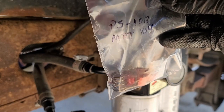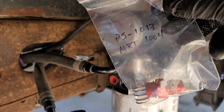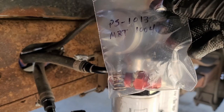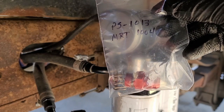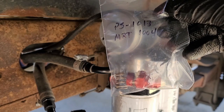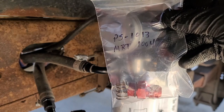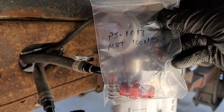FAST sent me a new return fitting and also a new spring. Here's the new kit that FAST sent out. It's PS-1013, MRT-1004. I think the PS is the spring and the MRT is the fitting. This is supposed to take the 7.3 and the 6-liter kits up to 60 or 65 PSI. They had them set at 50, and I think they were getting a lot of complaints with people's regulated returns — these actually come in the new pumps now. My pump is six months old and I must have missed that. So this is the part number we're going to put in.